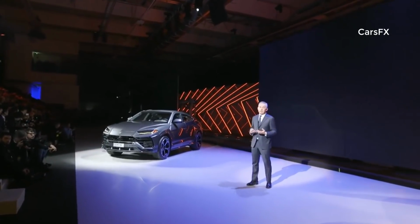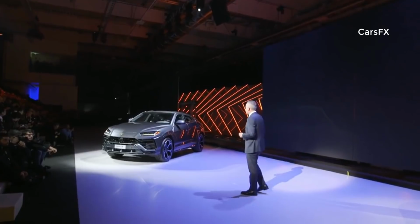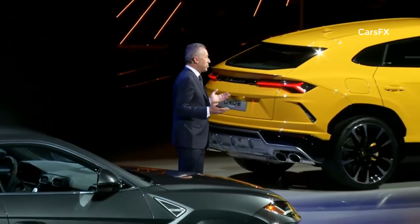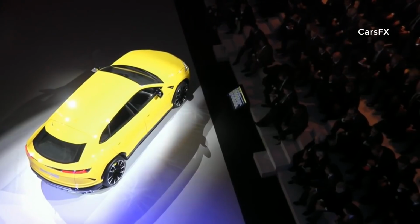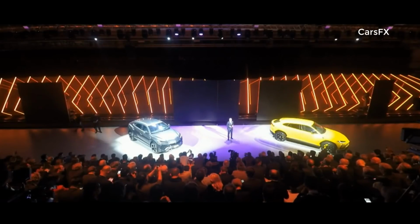And the purpose of all of this is, of course, for the vehicle to be on the ground, which means to have systems that make it possible to exploit all of this energy, all of this power. On Urus, for the first time, we've implemented air suspensions, which make it possible to have different ground clearances, which makes it possible to have a lower setting for the car when you want to use it on a racetrack or in a sporty way, or when you use it off-road, you can lift the car and increase the clearance in order to avoid any possible obstacles on the ground. This is not enough, of course, because also in terms of comfort, the air shock absorbers make it possible to have an optimum filtering when the car is used in city traffic, for instance, so it guarantees extreme comfort.